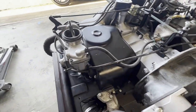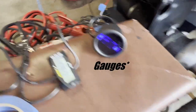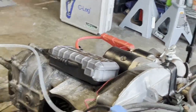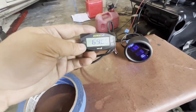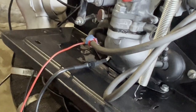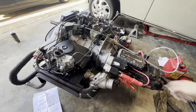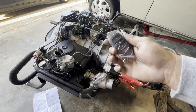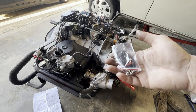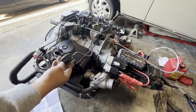Both carburetors are reinstalled back onto the engine. The fuel hoses are all hooked up, everything's all torqued down. I have the engine hooked up to a battery source. I've hooked up all my sensors to my separate battery here because the engine is going to be running off of that power bank thing. So I have my sensors here for the oil temp and the oil pressure. This is going to be the cylinder head temperature. And I also hooked up the tachometer — I hope it doesn't matter because technically I'm supposed to wrap that on cylinder one, but I wrapped it on cylinder three instead. I think it should be okay. I also wired up my remote start key fob here. I set it for the starter motor, so I'm just going to run the starter motor to get some fuel pressure and oil pressure.